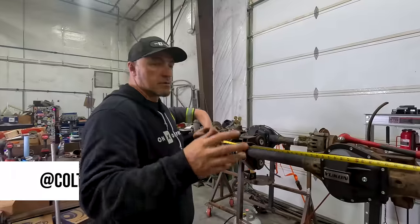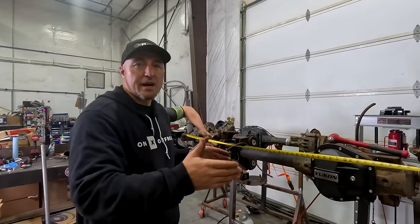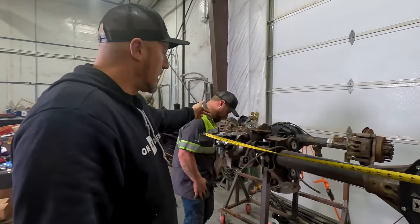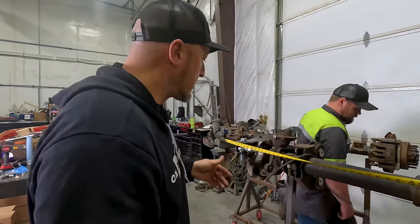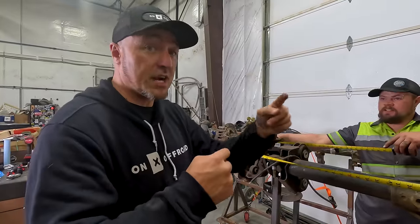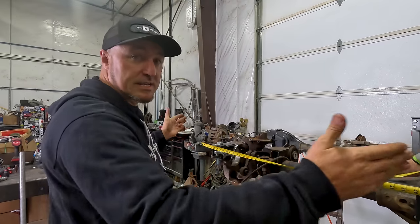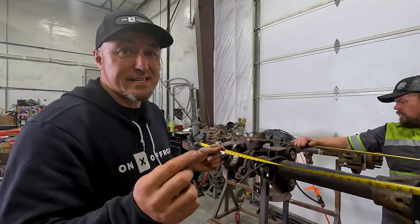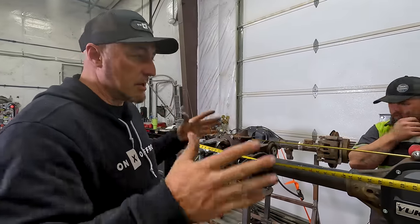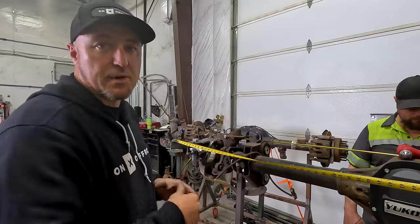We'll check in on them and see what they're doing. What we've got to do next is make our tie rod, and the only way you can make your tie rod is making sure your axles are straight. Hillbilly cut up a couple pieces of angle iron and bolted them in — they're squared up with each other. Then we're going to take a couple tape measures. Always make sure you're using the same tape measure, because sometimes they're a little off from each other. We're going to set the toe in about a sixteenth to an eighth, and then we can measure our tie rod length, cut it, and burn it in.